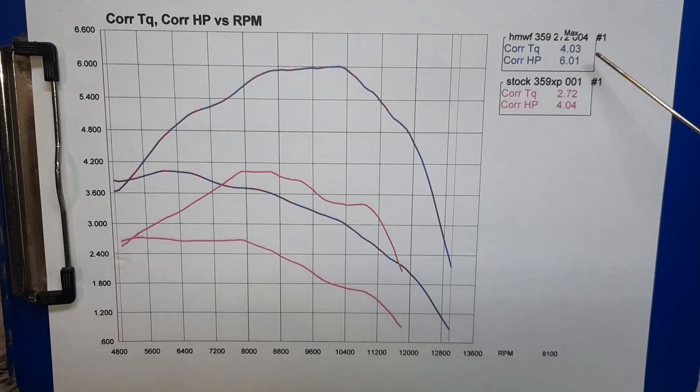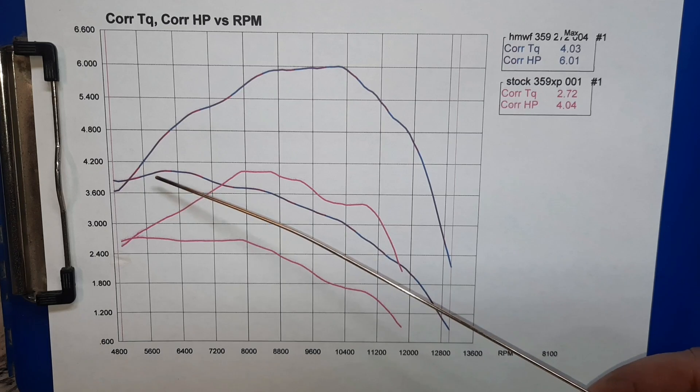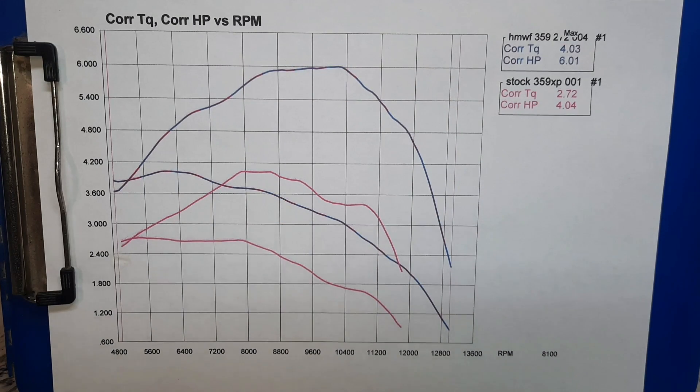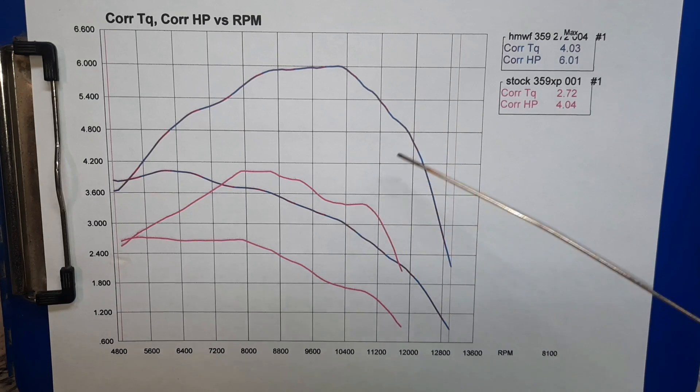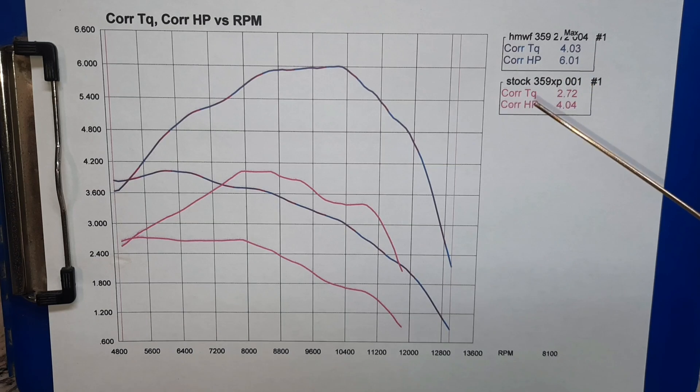All right, here are the results. We got 6 horsepower and 4 foot-pounds out of the top end swap, versus the slightly over 4 horsepower and 2¾ foot-pounds for the stock cylinder. You can see it makes all sorts of torque and does okay on the horsepower. Now this power is down for 70cc's — I'm actually kind of disappointed. I don't have the best luck with 272 cylinders anyway. Since we used the steel piston we really couldn't get any width out of the bore; it's at about 62% — I really like to go 65% or higher. Still, it's a solid build with lots of torque and a broad power range.